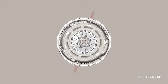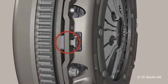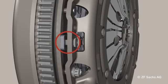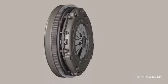For disassembling the clutch, all screws which connect the clutch with the flywheel are loosened constantly crosswise, step by step. Here it is essential to note that the stopper is lifted off the clutch housing. If necessary, the bolt must be loosened by lightly tapping on it. If the bolt in the housing is not loose, the adjustment mechanism is triggered during disassembly. Readjustment is no longer possible then.